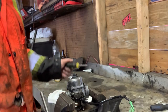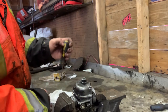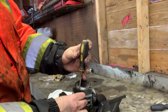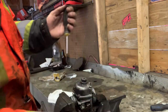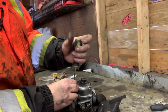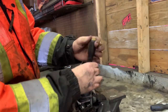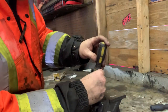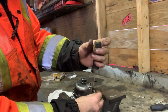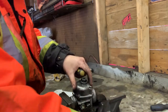I'm gonna show you guys what I'm doing - first time I've actually cleaned a Bravo carb, but I have a feeling it's not going to be much different than anything else. I already broke the screws free. Make sure you don't strip the screws - if you do, Vise-Grips are always a good trick to break them loose. Let's take off the bowl. This snowmobile wasn't running right, she was bogging, so let's see what she looks like inside.